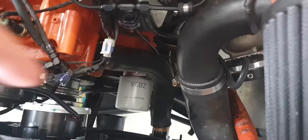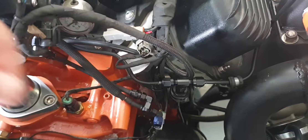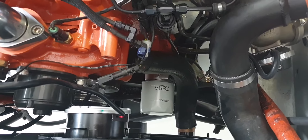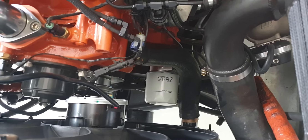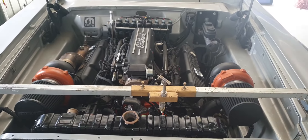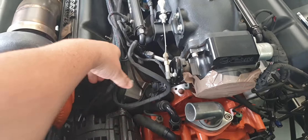Here's the new conundrum that this has created — a bit of a challenge with space. Down the bottom here, this little black pipe I'm pointing at is the boost return pipe, which needs to snake up and around into the throttle body. The nitrous solenoids plug in here, we've got an air temp sensor and all that other stuff plugged in, but with the motor here now that doesn't work. The oil filter needs to go, so I'll make an oil relocation kit and put that sideways. Hopefully we can get a pipe to snake up around here beside the radiator hose and into the throttle body. It's all fun and games considering how big this thing is and how much space I now don't have. I've still got some wiring to tidy up and finish.